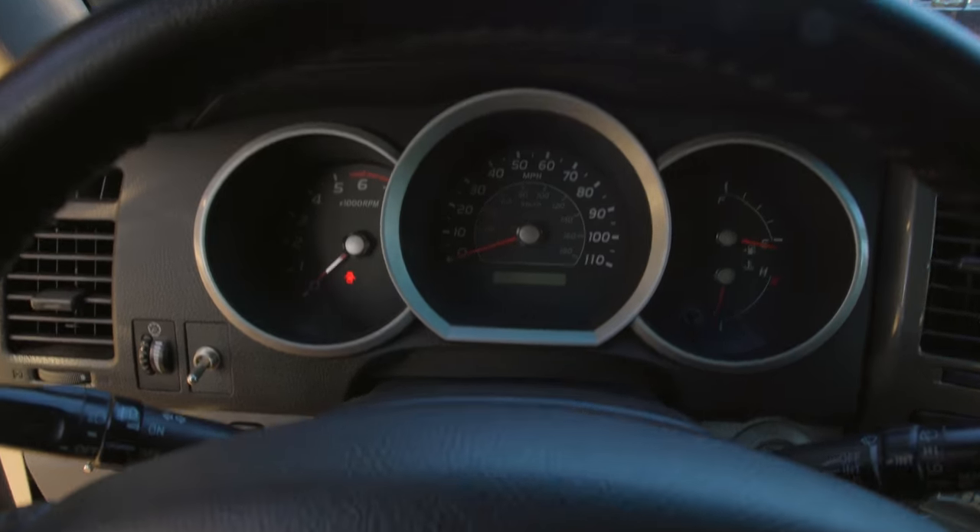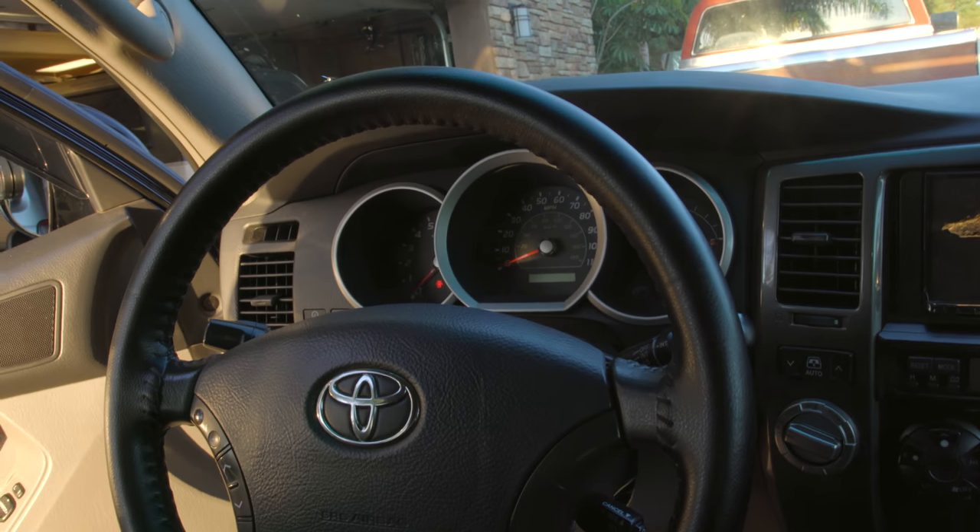Okay, so it seems my problems are gone. I went for a quick little test drive and ended up doing another half turn. It's a little hard for me to say how far off I was — maybe it was 10 degrees. I went another half turn, so I did a full 360 and the steering wheel is straight. That's exactly how it drives now. It's a shame Evan's Tire in Encinitas couldn't figure that out. Hope this helps if you've got the same issue. Thanks for watching and stay tuned for the next one.